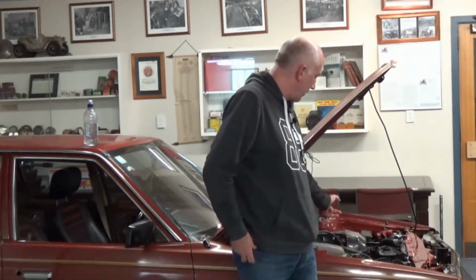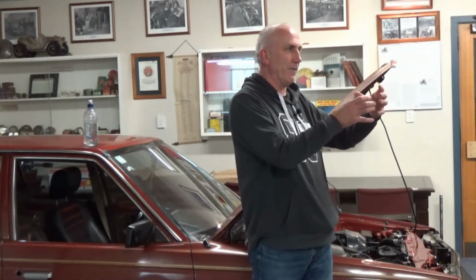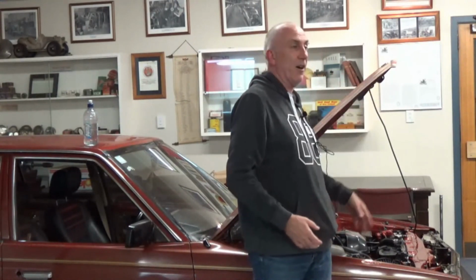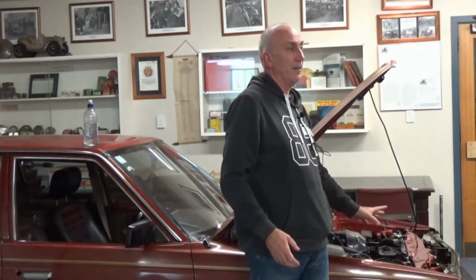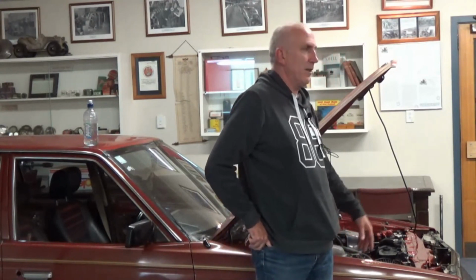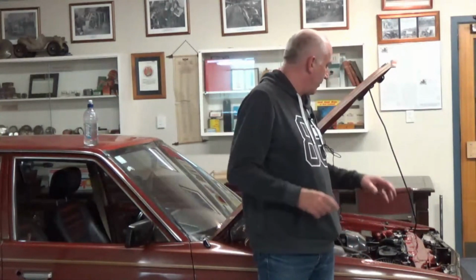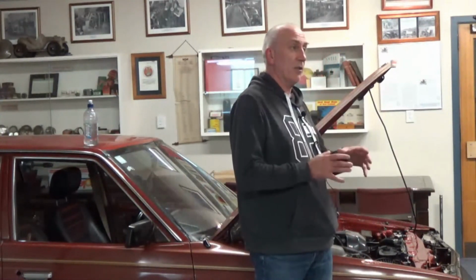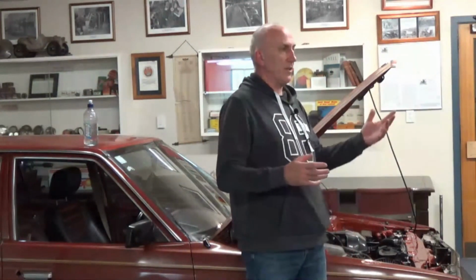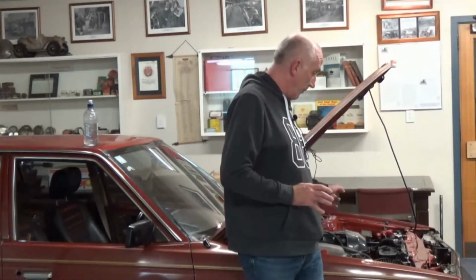So when I first started messing with the Altezza motor, we got one of these airboxes, cut this little piece off that holds the airflow meter, turned it into a tube and put a pod filter on the end of it. It started up and idled just fine, and it wouldn't rev out. That was really odd. We then put a factory airbox on and it ran fine. After a lot of messing around, what we found was that for some reason, the airflow meter needs turbulence, which is contrary to the V8s, anything else I've had with the Toyota that runs a hot wire airflow meter, doesn't care. But these ones really do.